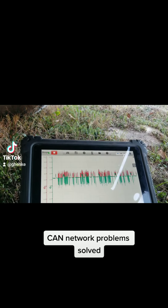Still on the same network, showing 122 ohms. One terminating resistor is in the PCM, and one is in the very back of the truck on the frame rail. I actually took it out and have it right here. I'll go ahead and test it in a second.